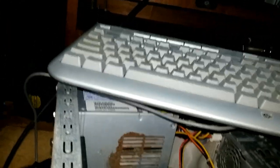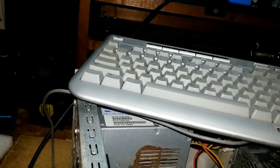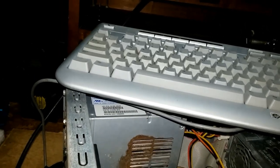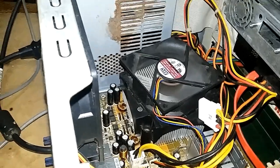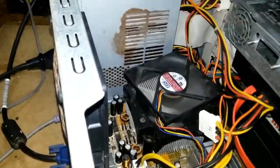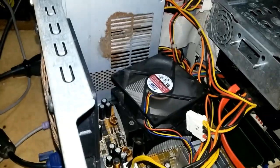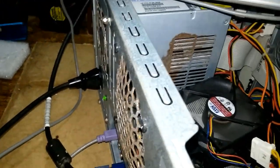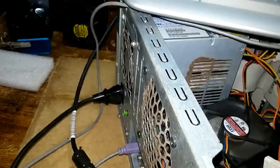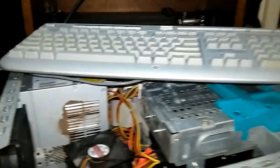All you have to do if your PC goes down is disconnect all the hardware and boot up. If it still gives a problem, take out your memory sticks. You might have one, two, or three. Put them in and try it one by one, you ought to find the problem. Now, in a next video, I'll show you how to test a power supply.